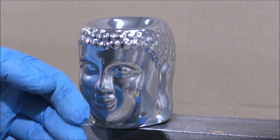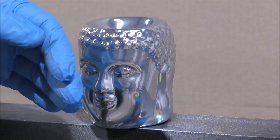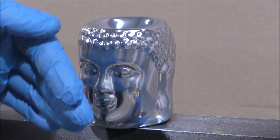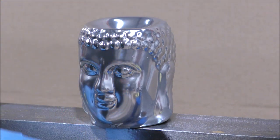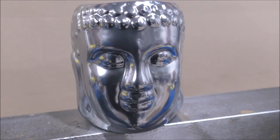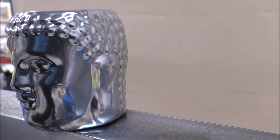For interiors such as shops and displays, a white finish is really nice as it gives a good clean bright finish. When you're happy with the desired effect achieved, allow the silver to flash off for a few hours, as the solvents within the silver will have slightly softened the Direct Gloss, so we need to make sure that all the solvents within this coating have evaporated before going to the next step.